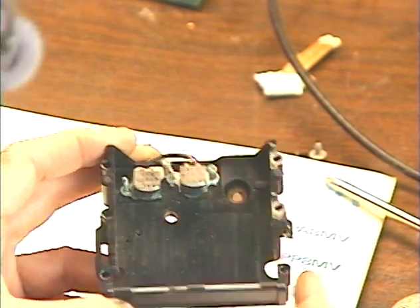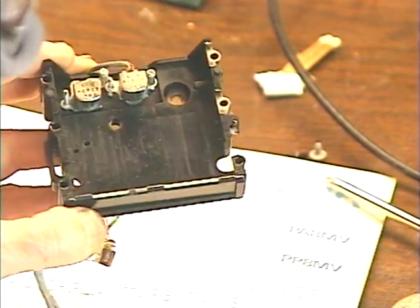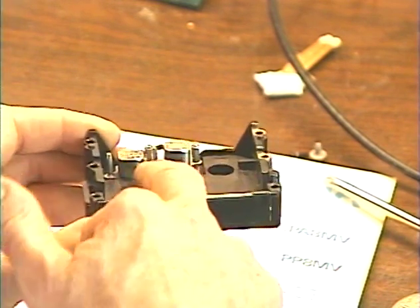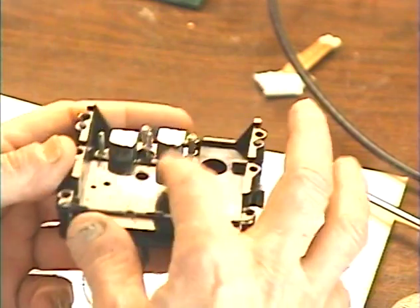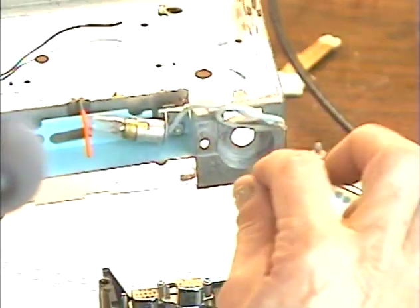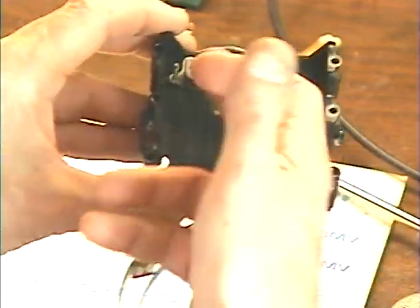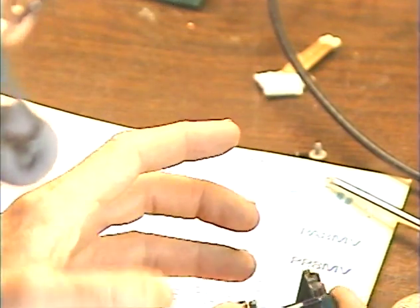This car unit is a little different — it has two heads. On a standard 8-track, this location is normally where the automatic track-change sensor goes, detecting the metallic splice. This unit actually has a head in place of that sensor. So even though stereo play tapes were theoretically possible, a stereo tape would not play properly here because track two would occur about a second after track one — a garbled mess. Accordingly, this Volkswagen car unit only has two positions: Program 1 and Program 2, with no stereo position. It's strange they used two mono heads instead of one stereo head.